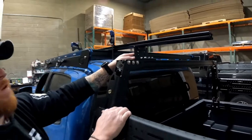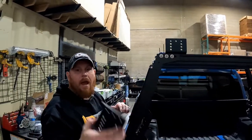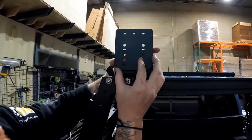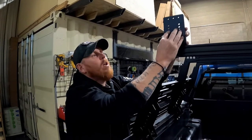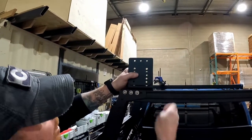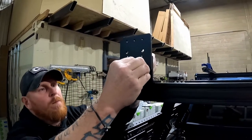We're not going to have to use the elevators on this truck. If you require more height than just the L-bracket by itself provides, you're going to want to remove the hardware for the upper connection point for the load bar. You'll use an elevator plate to adjust it into position and raise the height up. The load bar would be connected here to raise the height to the suitable level you need. You're limited to where these holes will actually align, but two bolts in each connection point is fine. If you're using the elevator plates, you'll use the included M8 hardware — the larger hardware of the two — to put it into the position that you need and align the holes. When it's in place, install the nuts on the back and tighten everything up with an Allen wrench and a wrench.